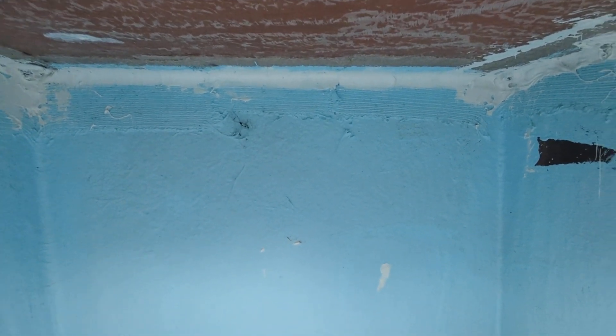In the live well you can see where I've put some 4200. I'm gonna try and talk soft — this is echoing in here. Anyway, you can take a basting or an icing knife — basically a cake icing knife — put your heavy bead and then seal that around.